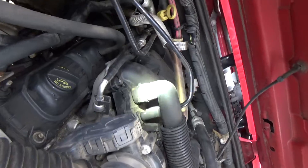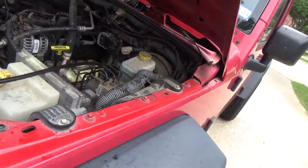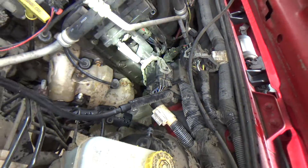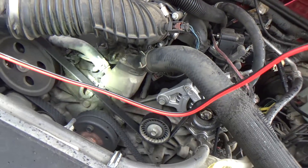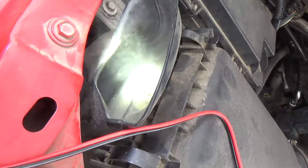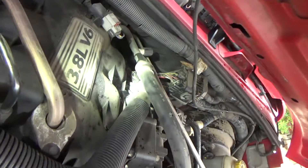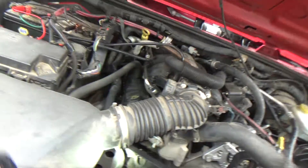We obviously have a leak and it looks like it's definitely going straight to the intake — it looks like it's going to the top of the valve cover. I don't know if that would actually cause a drivability problem right there, but it probably would. I'm not seeing anything else and just making sure my pressure's not building up. You can see smoke coming out of the intake inlet. The only thing I'm seeing is that right there, so I'm going to look into that. Everything else is looking perfectly fine.